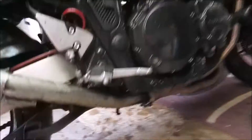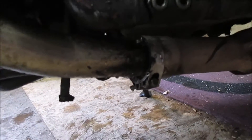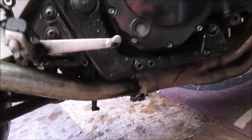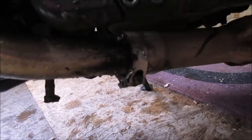I've got to take the exhaust off the Bandit because, as you can see there, it isn't sealing. That clamp is completely useless. I'm going to take the dump pipes off because that collector where it meets the link pipe is oval, so I'm never going to get the new gasket in.